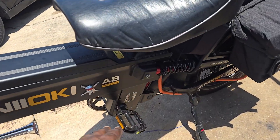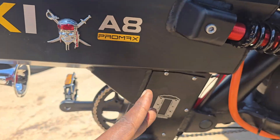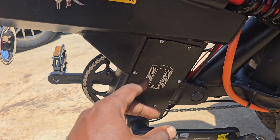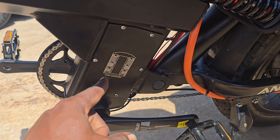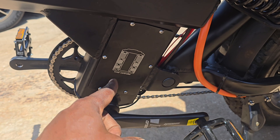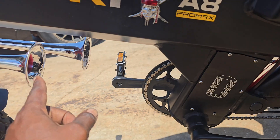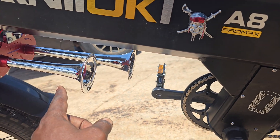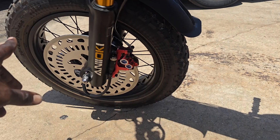Inside this box, the battery has two plugs — two XT90s going into one QS8 connector going into the controller. We also have a step-down converter, 20 to 90 volts down to 12 volts, and that's to run his horns that he got from a boat, which are crazy loud.